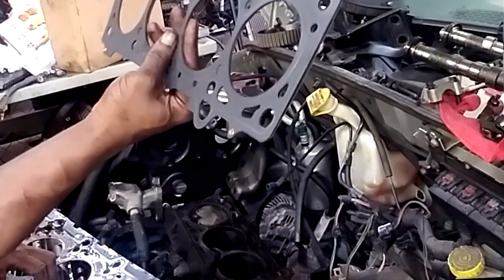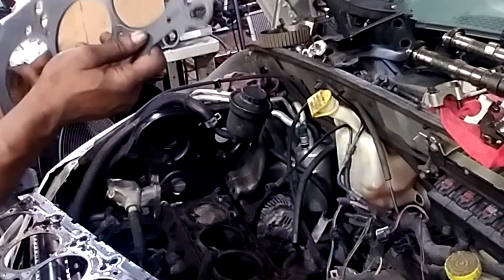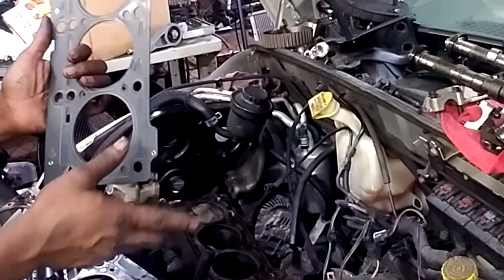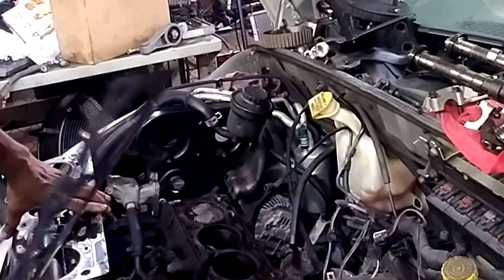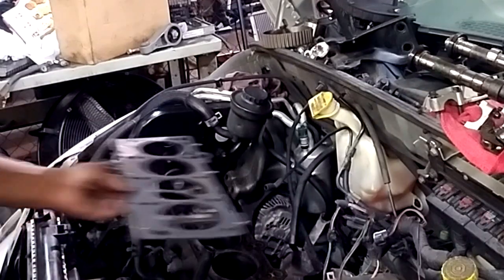There's some spray that Chrysler recommends using on these gaskets, though I've heard you shouldn't use anything on them. For the most part I've been applying a gasket maker, because I read from a Chrysler engineer that you should coat it with gasket maker — but I don't coat the whole thing, just set it down and set your head on it. I'll find out how accurate that is and get back with you. Let me finish putting this engine together and I'll see y'all on the next video — thanks for watching.